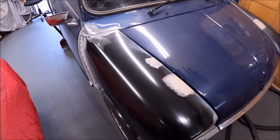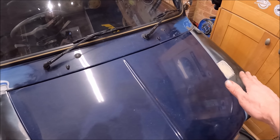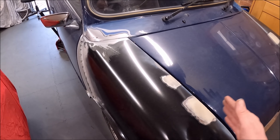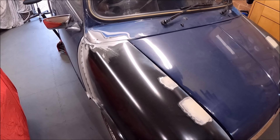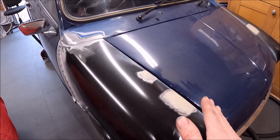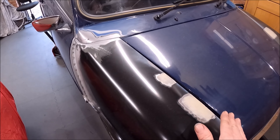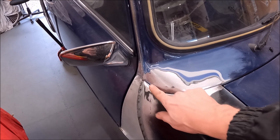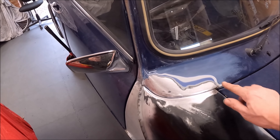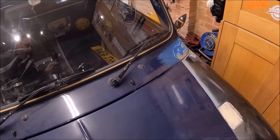At the front here I've got a couple of small repair sections — these are my own mistake. These are where I dented the wing upwards a little bit trying to get it in because I was hitting from underneath. So I've dollied them back down and then just put a skimmer filler over the top. They were high spots; they should be low spots now. And then I've cleaned up the corners here because we're going to be seam sealing these corners, both sides.